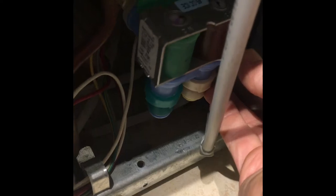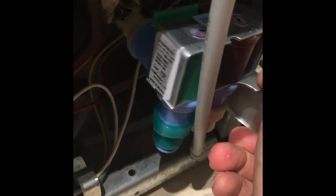I'm going to make this short and sweet. When you take your old one out and open up the back panel, you'll see it sitting in the corner held in by two screws. Certain electrical connectors connect to the top valves to actuate the solenoids. When I took mine out, I left it and took pictures so I know which tubes go where and which connectors go where. I'll use that when I put it back together.